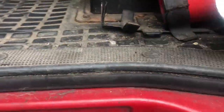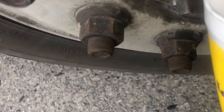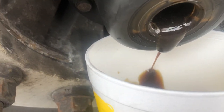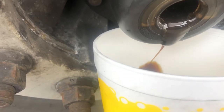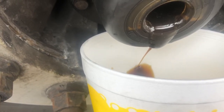I'm going to stick it down in here. Here's the cup. My hands are getting dirty, so I'm going to have to wash them. We're going to pop this thing off. Watch this. There you go. That's too much — that's extra grease. I'm going to let it pour out because that's way too much. It's leaking out, causing a mess, and DOT can pull you over. You might think you have a broken seal, but in reality you don't. Way too much grease.